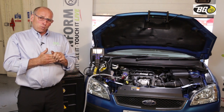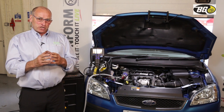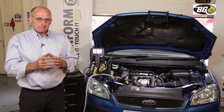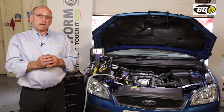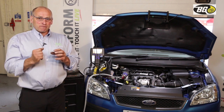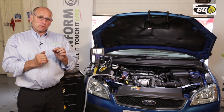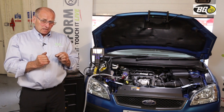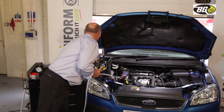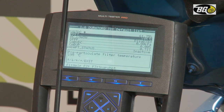On with the process. What we're doing at the moment — whilst off-camera — is building up the temperature of the DPF internally without any product going through the engine system. We need to establish the correct vacuum in the manifold by adjusting and selecting the right vortex generator and setting the engine speed. The engine speed is around 1,500 RPM and the temperature is just under 200°C, having peaked at around 255–260°C.